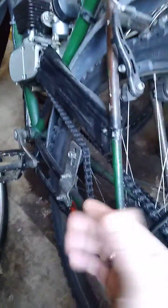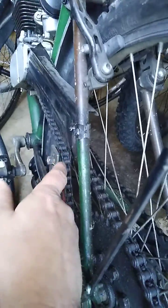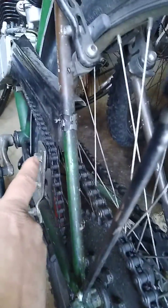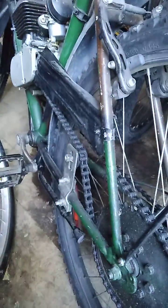The second thing I want to say is: don't bend this bolt. Don't. If your tensioner is a little bit pitched, that's fine. These nylon wheels will actually wear to the pitch of your chain as your chain stretches. And this tensioner here has over a year on it, and as you can see, it's paper thin, but it's just the way it's supposed to be.